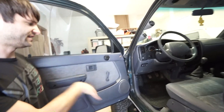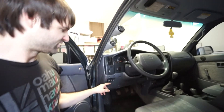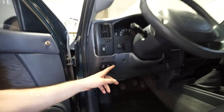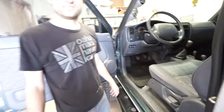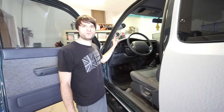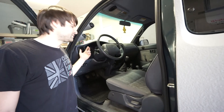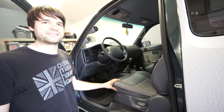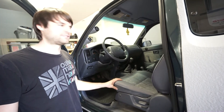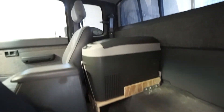On the driver's side, the ARB compressor switches are mounted low — compressor on, rear locker, front locker — and being low means the indicator lights don't shine in your eyes, which is really nice. There's a two-pillar gauge pod: the lower gauge is the boost controller and the upper is the AFM air-fuel meter gauge. The rest of the interior is pretty standard base truck — everything is manual, the only features are air conditioning and the heater system, both of which work great.